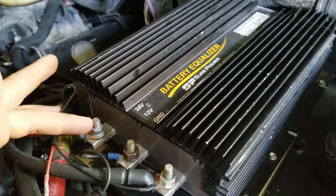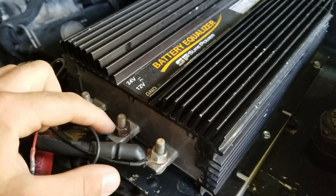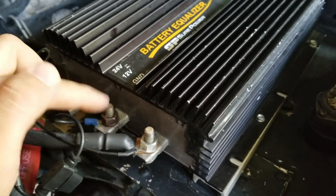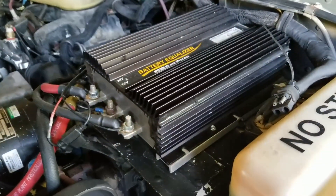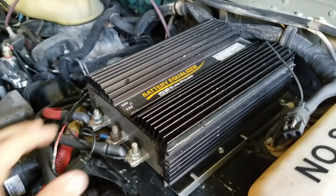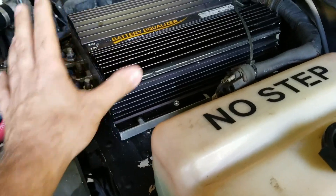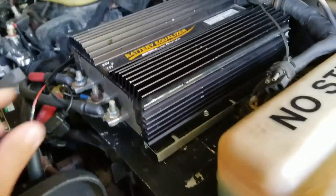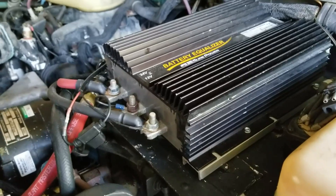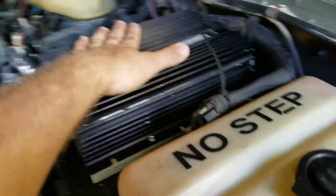Those are the metal fans. Battery equalizer — it's 24 volt. Power comes in here for your batteries, and this is your 12 volt, so I have the sound bar running off of this and you can run 12 volt accessories from here, and your ground. This will also keep your batteries equalized so that with two batteries, any overcharging or uneven draw doesn't happen. It's a great piece. The only drawback is it does draw a tiny bit of voltage, so if you had long-term storage you may need a trickle charger.